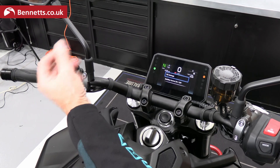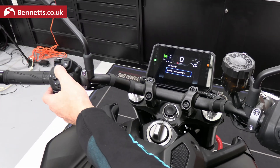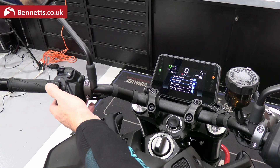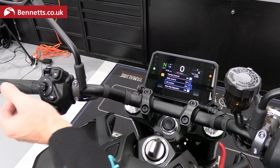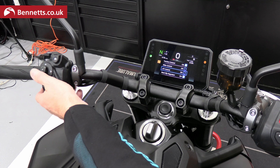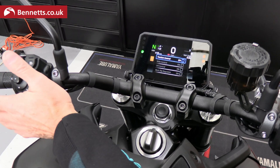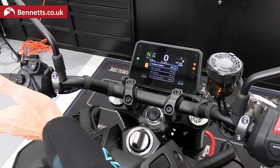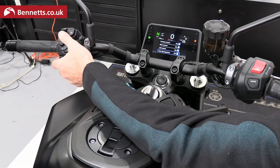There's also the facility to download these modes through the app. And there's stability control — another area riders might want to play around with to set the bike up as they wish. Clicking into Stability Control, it's possible to turn functions on and off. If you want no lift control, the bike will accelerate even when the wheel is lifting, and you can switch that off. The important thing is that if you turn traction off, that turns everything off, because you need wheel speed data always. So traction has to be on if you want the other controls to function.